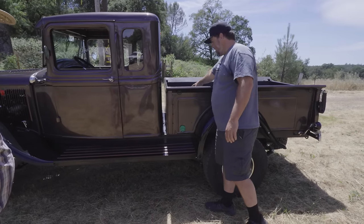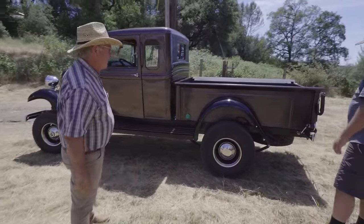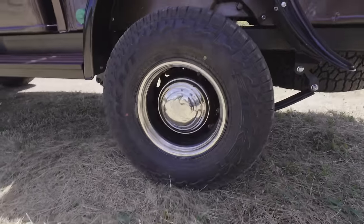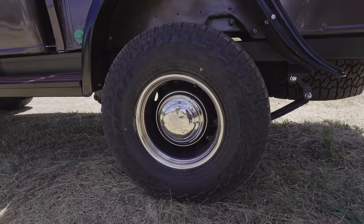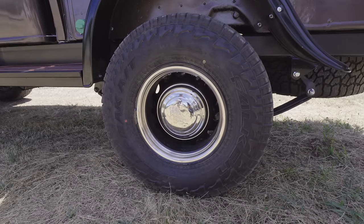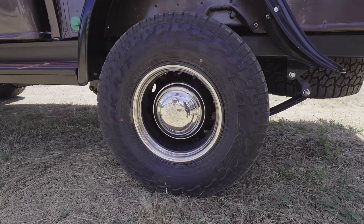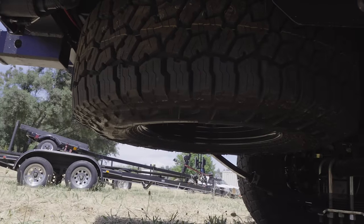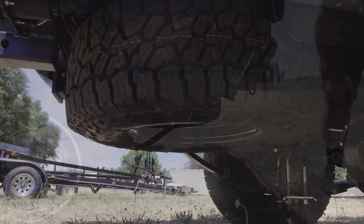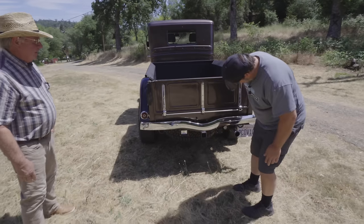You've got a green gas cap — that's where you put the diesel. There's a tank between the frame rails. The bed is stock — factory length and width. The wheels are just artillery wheels, 15-inch, with trim rings and a forward hubcap. I wanted something really basic and simple, not a mag type — it classically fits the build. You had to cut a hole in the front ones for the locking hub to come out. And there's a full-size spare tucked underneath — a crank mechanism that lowers it down when you have a flat.